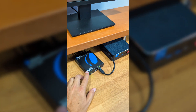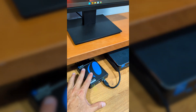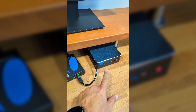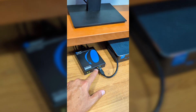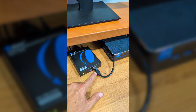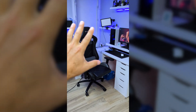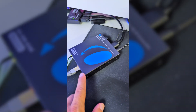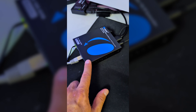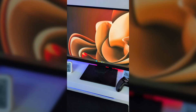This is the main computer connected to the HDMI KVM — the EX500 KVM, a 4K 60Hz HDMI KVM over Ethernet with IP. I have this computer connected via HDMI so it inputs the signal, and then I have an Ethernet cable going to one single switch at the back. From that switch, I also have another Ethernet cable connecting to a receiver unit — also an EX500 KVM — and here I have a USB dongle so I can control the computer from this location.